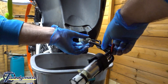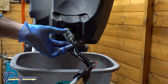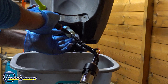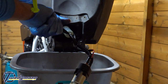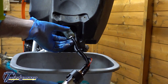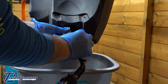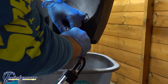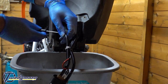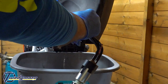Only pull out as much pipe as you need. Now to remove the single-ear clamps - you might need a special tool but just some pliers will do. Cut right at the top of it, give it some brute force, then spread the clip a bit and slide the pipe off the fuel filter. I'm just sticking a screwdriver in to try and break the seal around the filter whilst pulling on the pipe as well. Then she's going to gush with fuel, so be ready.